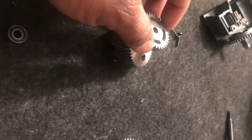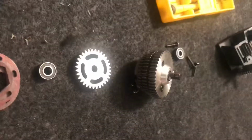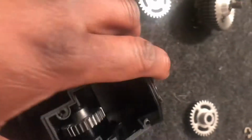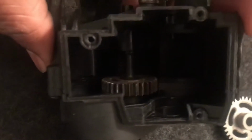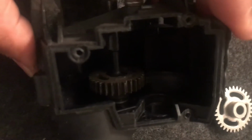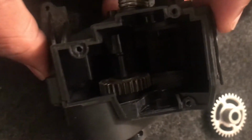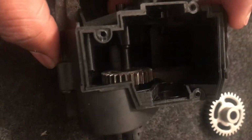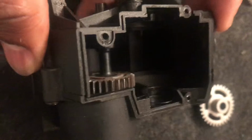So this goes here, right? And it rides on, where'd it go? This thicker gear here. Now, this also is custom, unique to the 2-speed. The 3-speed gear down here is very thin, and then you would have failures here because of the higher stress, because the area carrying the load is so low.